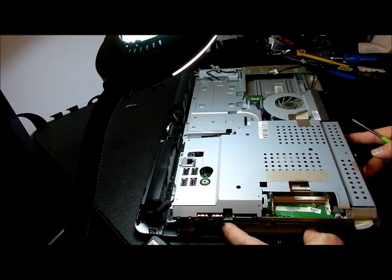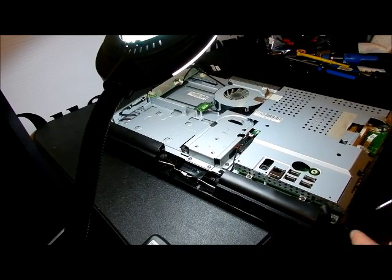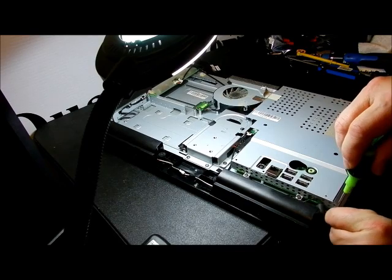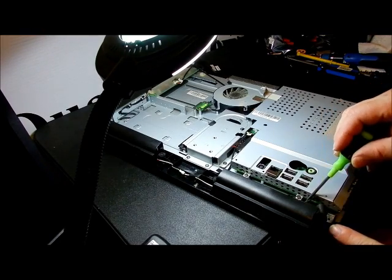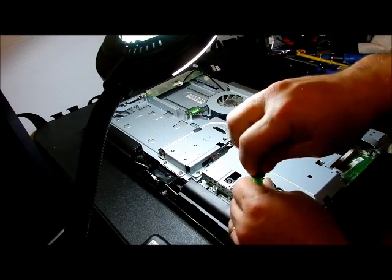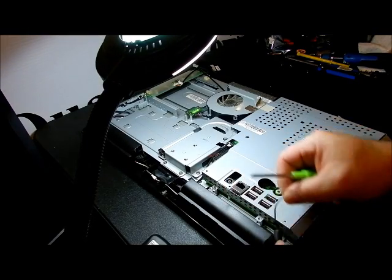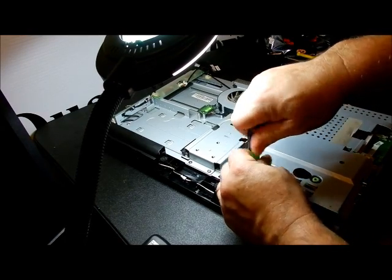We have two screws on the sides again. I'm thinking that's holding the LCD screen in place. We have screw number 3 here. We have a grounding wire right here. That's right above the speaker. Actually, yep, right above the speaker. I'll take that out. That's going to go in a different stack of screws. So that's going to stay with the speakers. That grounds out the speakers itself. Screw number 4 is behind the speakers.